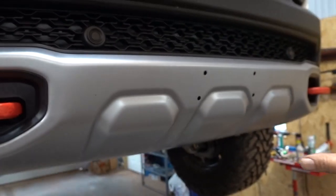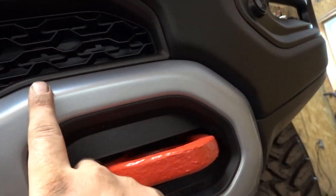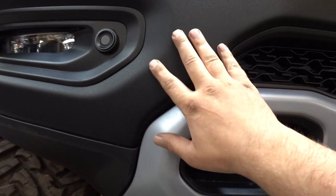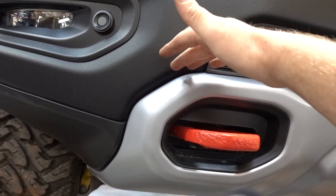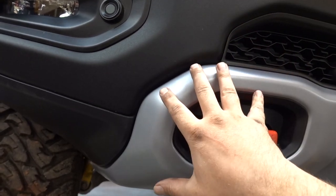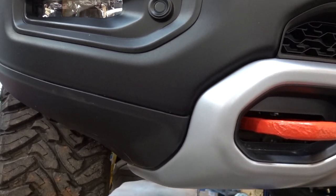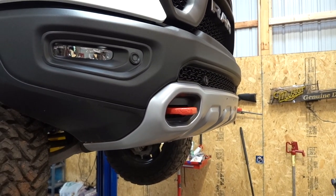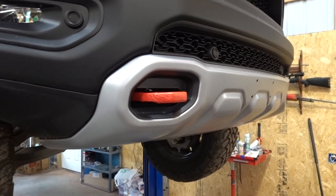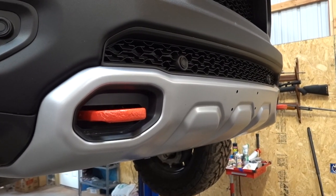So I've taken a bunch of the bolts out already. As it turns out there's actually a bolt here and here and the same on the other side, and there's really limited access in behind here. There's like a piece of metal almost right above where the bolt head is, and if I were to get them out I would probably have to loosen them both at the same time. It's just really no access in the back there. I think for as much as we're doing here I might just pull the whole bumper off just to make life a little easier for the reassembly process, and obviously once we have everything out we can set up where we're going to put our light bar and get everything situated without having to struggle.